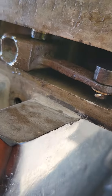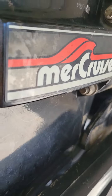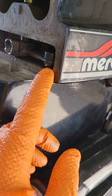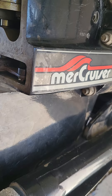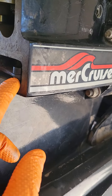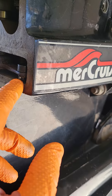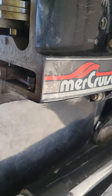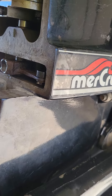As you can see on mine, I do have surface rust, and I did replace this arm at one point. What happened was this arm right here — this dowel — just started wearing out and then it snapped as I was coming into the dock. We were at Lake Powell and I ended up pulling apart my drive and found that it had snapped. I was able to get a piece of it and feed it back through and finish our trip, luckily. I've seen that snap and that's a bummer.